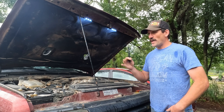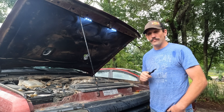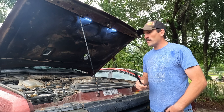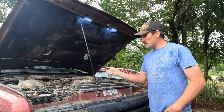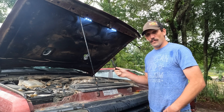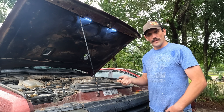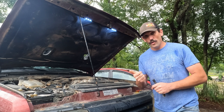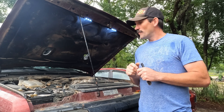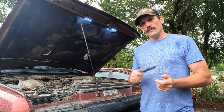I let it sit for a little while, had something to do, came home, and the truck fired right up first try. Yesterday I got in it, cranked it up, drove fine, went where I needed to go, came back, stopped at my mom's house right down the road, got back in while it was still warm — another crank-no-start situation. This morning I got in it, cranked right up, but the truck went into limp mode: the Sport light was flashing on the dash and the truck mechanically locked itself into third gear.